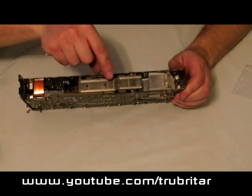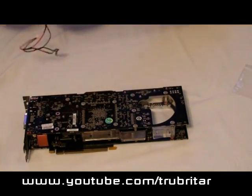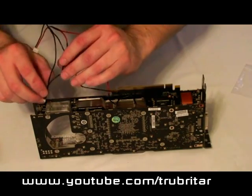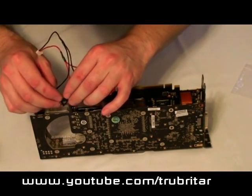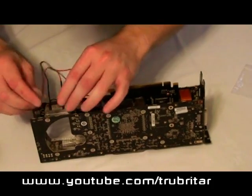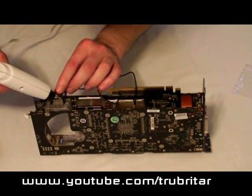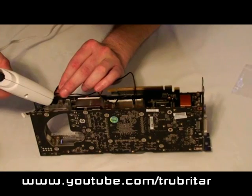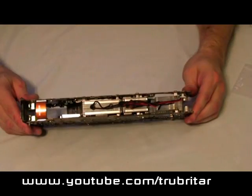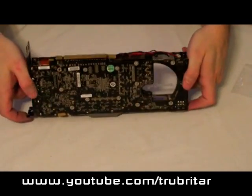And there she is. All we've got left is to install the LEDs in these holes. Just pop the LEDs into the holes. The connector plugs in where you would normally have your heatsink fan connector — it just plugs straight in there for the LEDs. Use the hot glue gun to hold all the LEDs in place. Lastly, neaten up all the cabling on the back of the card so it doesn't foul anything, and you're complete.